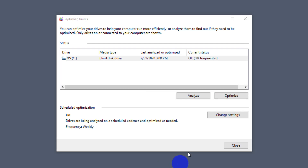The process is now done. I first analyzed and then defragged the drive — it took about 20 to 25 minutes. I was only using about 270 gigabytes of the one terabyte 3.5-inch drive, and the system is only about a year to a year and a half old. It came back as 0% fragmented, which means there were no fragmented files or folders on the disc. You definitely want to analyze and defrag your 3.5-inch drive before the cloning process. You don't need to do this for an SSD drive.